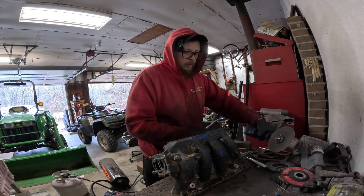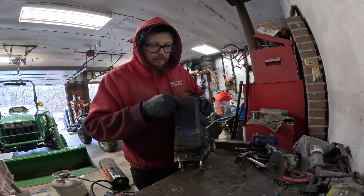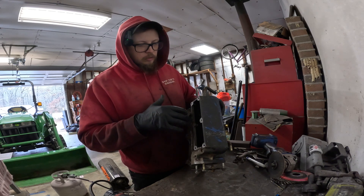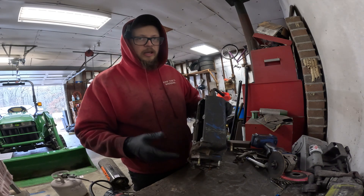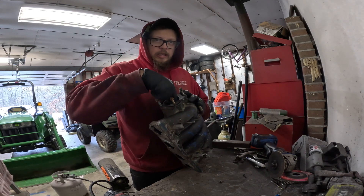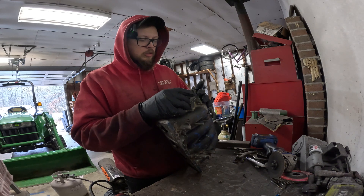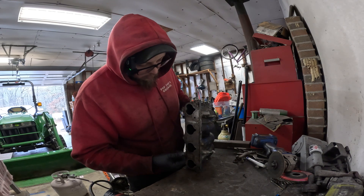What I'm going to do is keep this plate off, cut the top out so I have full access to the runners. You could probably knock those out, but I think it'll be best to keep them — they look almost like velocity stacks, so I'd like to capitalize on that. Also, this throttle body opening looks smaller than an RBC one, so we need to open that up a bunch.